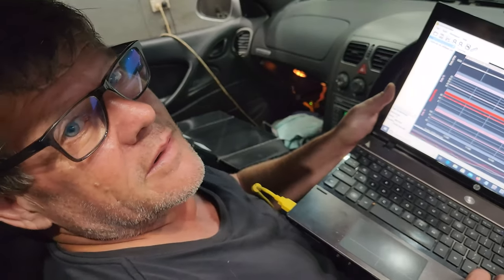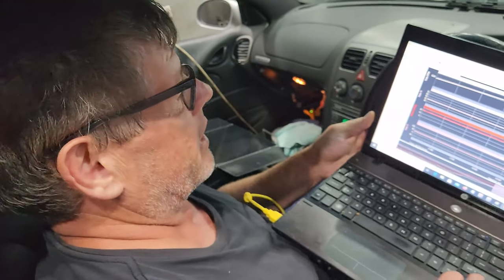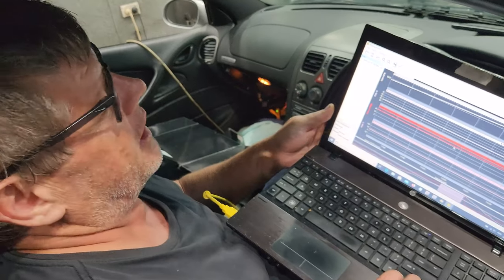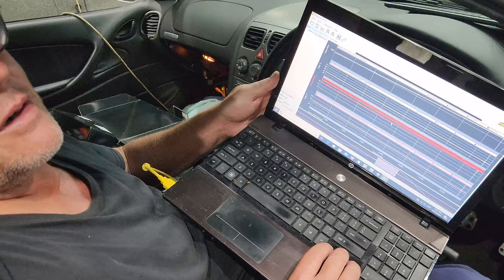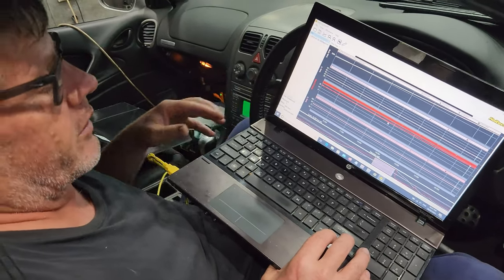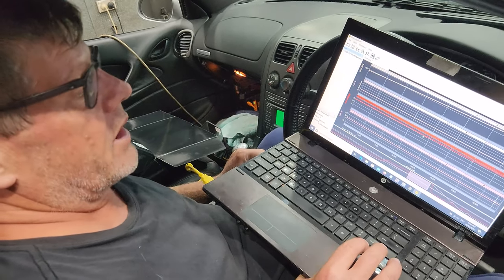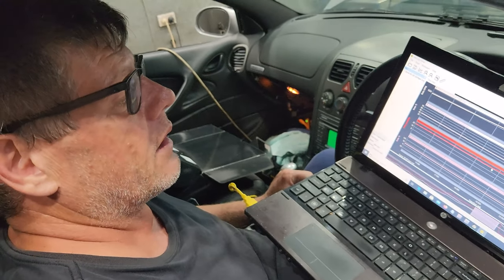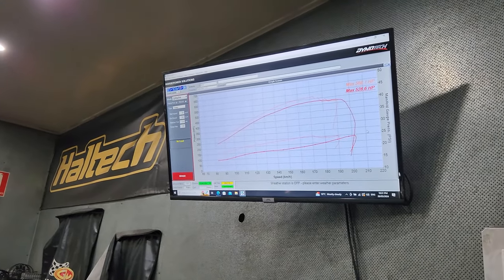Apart from you working very hard tonight, the water-to-air coolers are working very well. They work brilliantly — best invention ever. Water-to-air coolers, they're heavy, but worth it. So what's the go from here? New belt, get some right spark plugs, smaller pulley, some more tension, and we'll whack her up to about 32–34 pound. We should happily crack well into the deep end of the 600s.